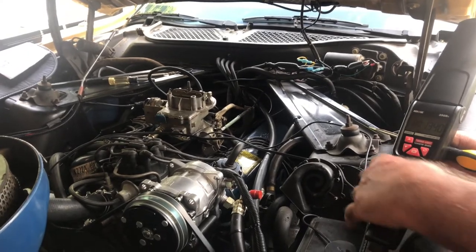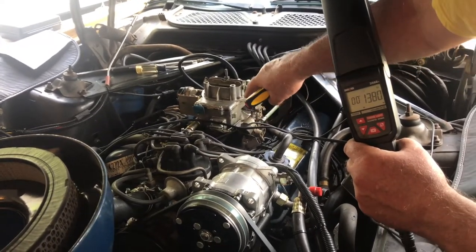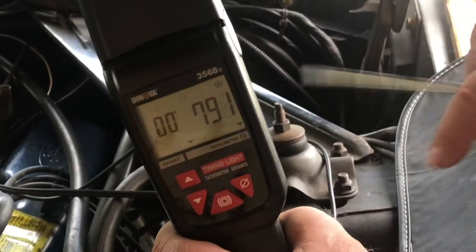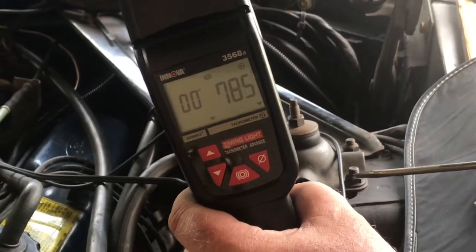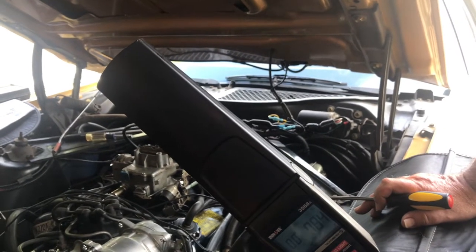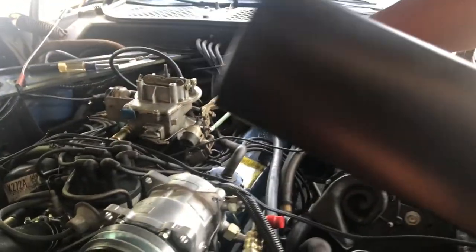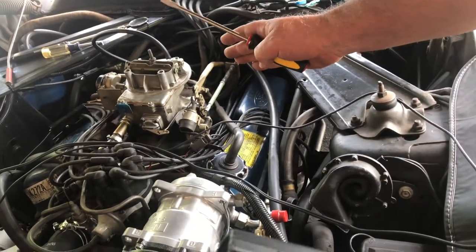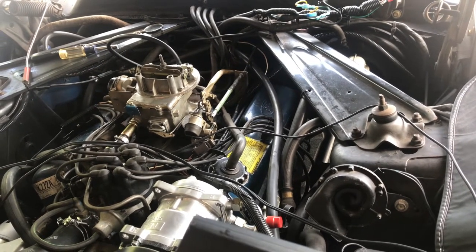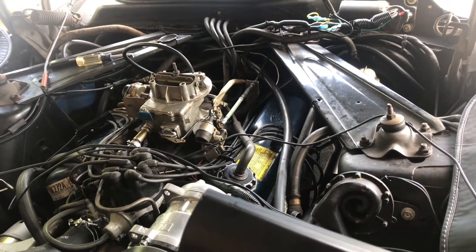Now what I'm going to do is open the throttle a little bit and then come down to the throttle position solenoid pin. The high speed idle cam drops and the engine drops to 800 RPM. If I put the car in drive it would be about 650 RPM, which is what I want. But when the engine is turned off, the solenoid pin drops and the carburetor's throttle closes a little bit more. I call it the throttle solenoid off position — it's also called curb idle or base idle — and we need to set that.